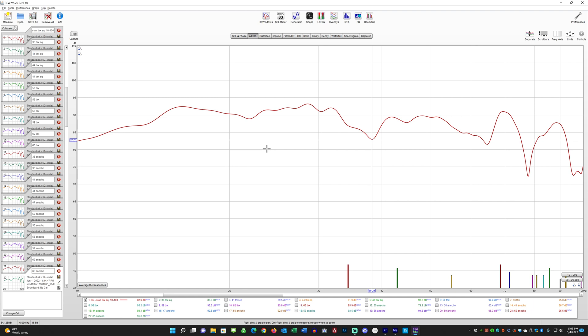This sub is a dual 12 — two 12-inch drivers in one box — and there are two different EQ settings to choose between. There's no way for me to find a non-EQ'd setting, but I think the EQ is what's really the magic for this subwoofer, because I tried to blow this thing up. I pushed it as hard as I could to see if I could make it skip a beat. With a lot of subs that are just amplification and driver, you can cause some damage, but the EQ built into this really controlled things so that no matter what I did, I can't kill it.